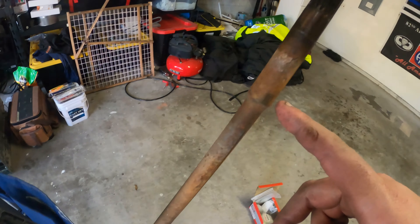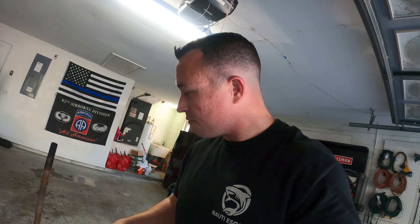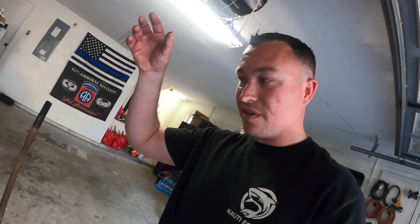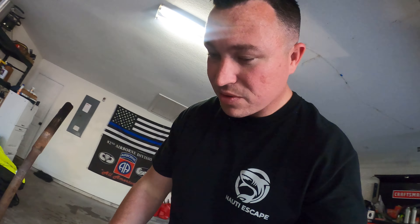This shaft right here — it's not a must, but I would absolutely recommend taking a wire brush and cleaning it up a little bit. One more thing: when you put the new impeller on, it's going to be really stiff. If you have vaseline or some sort of ointment, rub it down on the shaft throughout here and it will sit down very tightly but also very smoothly.